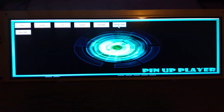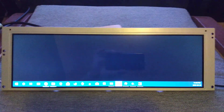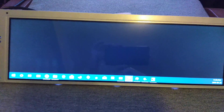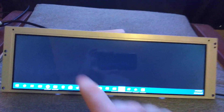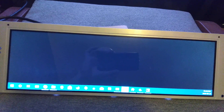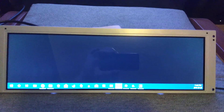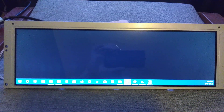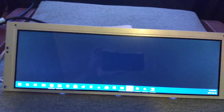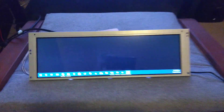It works out really, really well. Some guys were getting confused on how to fix this. You can make things work with 1280 by 720 squished, but there's no point — you're wasting pixels and getting weird aspect ratios. If you do what I showed you, you're running at the correct panel resolution, your front-end videos will display correctly, your DMDs and every program will display correctly. That's the right way to do it.